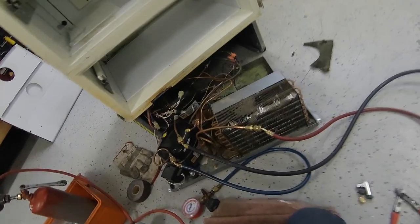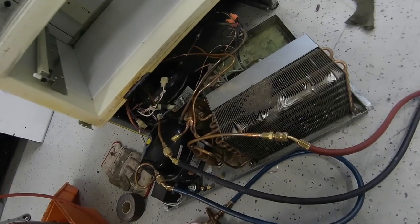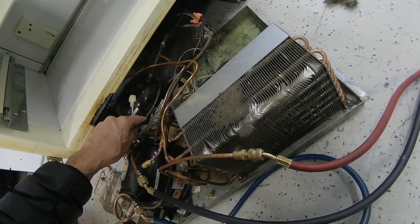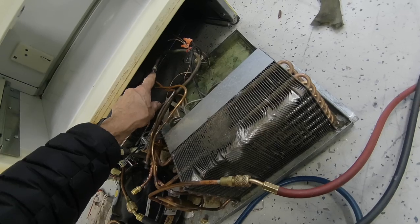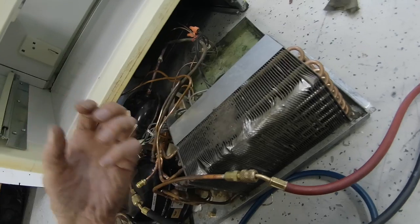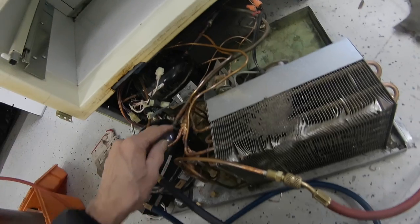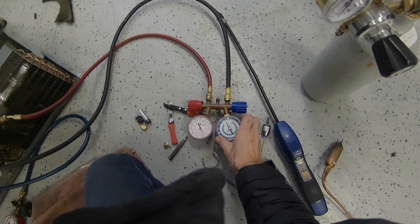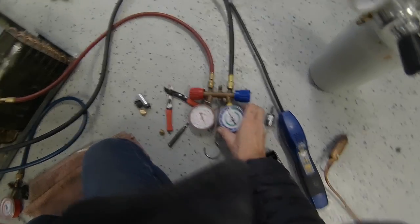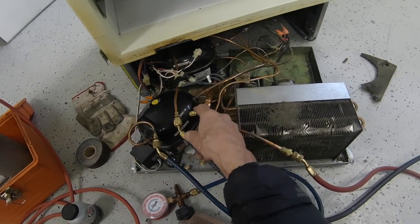On this video I'm going to show you how to do a sweep charge. I just repaired a broken line on the suction line for the refrigeration compartment and put a little piece of 5/16 tubing in there — it was a little short and I didn't want to bend it and kink it. We've also replaced the filter dryer and pressurized the system with nitrogen, up to about 250-300 pounds. I'm not getting any leaks — I checked all the joints.